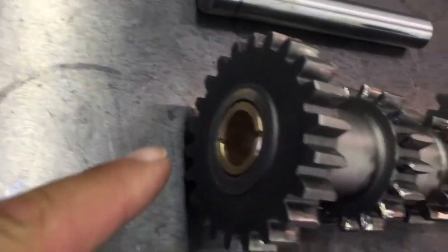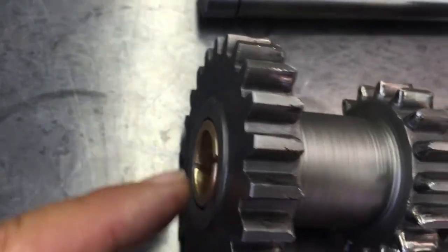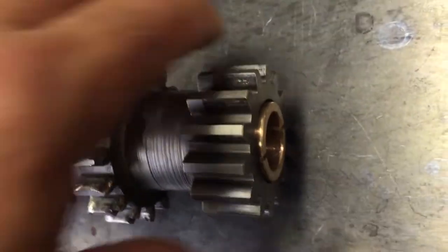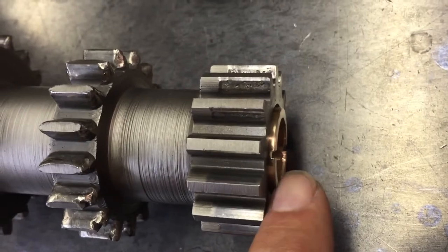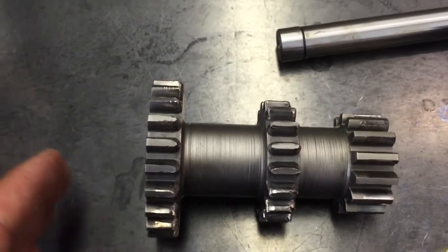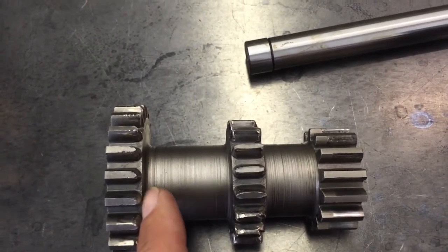It's important that the bushing be flush at this end — it must be flush with the surface of the gear and must not be sticking out beyond it. All the end clearance is done at the small output side end. It's important to do all the end clearancing setup at this end. Otherwise, if this is protruding out and you're sitting in neutral, the slider gear will actually — and it doesn't take much, just a few thousandths — be rubbing up against it in neutral.